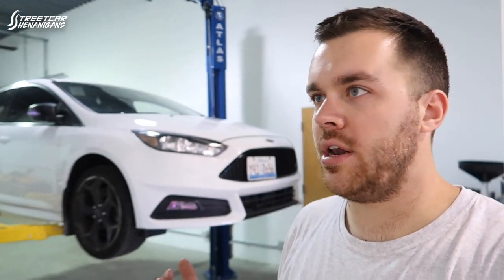So we do have a Ford OEM clutch going in it. After doing some research we were thinking about doing a Stage 1 system, however the Stage 1 clutches from SPEC for example are like twice the price if not more, and they are not really rated for a whole lot more than what people are getting out of the factory clutches. Trish doesn't have any plans of putting a big turbo or auxiliary fuel system on this car, so we didn't really find the necessity to do that. We were thinking about doing an aluminum flywheel even with the factory clutch, but nobody had one in stock — not a Fidenza, not a SPEC — and some websites showing stock weren't reliable enough for me to spend $500-$600 only to get a back-order email ten days later. So we just decided to go with OEM parts.